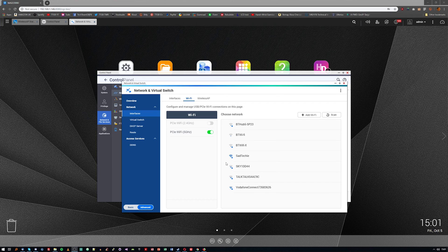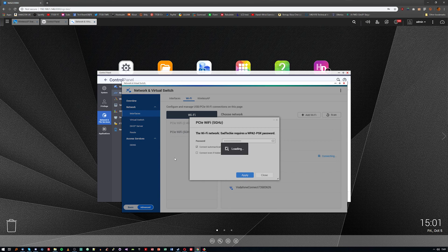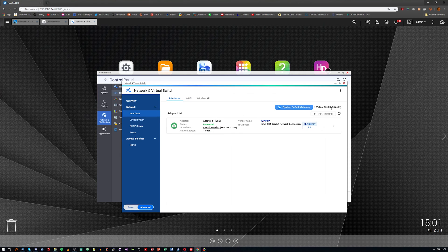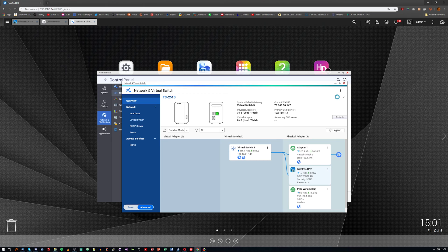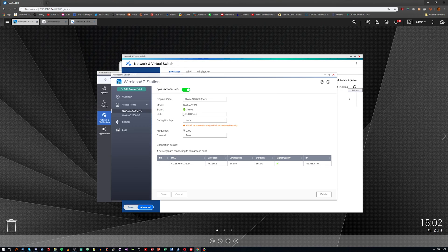You can also go into the network settings in the general NAS and manage any direct connections to your network using the Wi-Fi. Bear in mind that if you want to use this as a failover — say you've got Ethernet plugged in but also want Wi-Fi connected in case your network switch dies — you can do that. However, you can only use either the 2.4 or 5 gigahertz band for either an access point or that failover connection, so you'll have to pick one or the other.